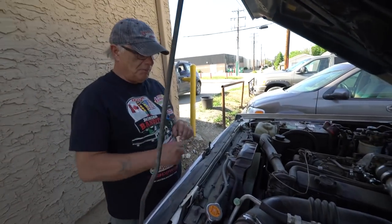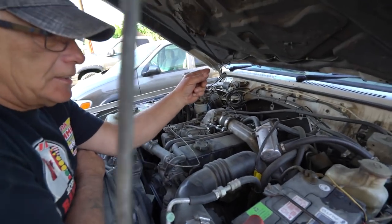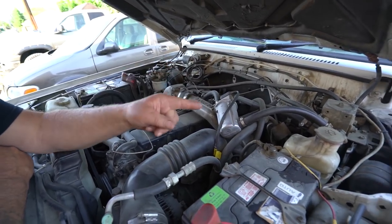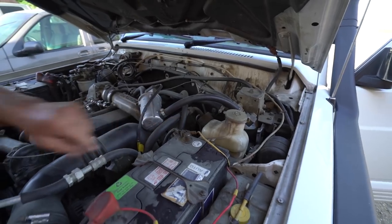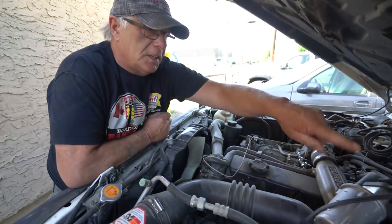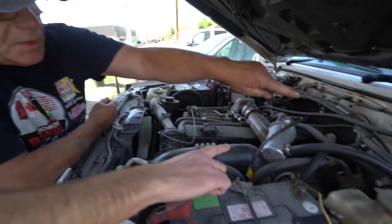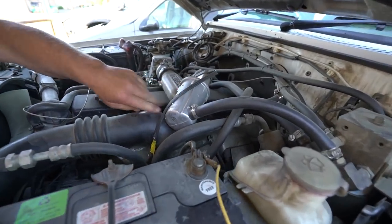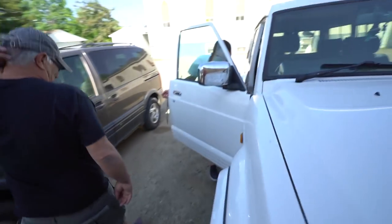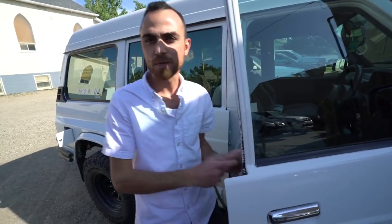Badge, want to give us a quick tour of what's going on inside this engine? Basically he's got two tanks, two pumps at the back that pump up through the filter housing — he uses the same filter housing. One is diesel and the other is veggie. And this is just to keep it warm in the winter. Easiest way to filter oil is pantyhose, boys. You cut them in two — I always have spares by the way.